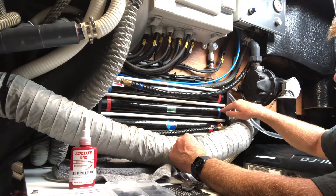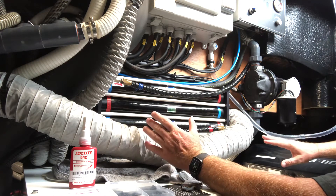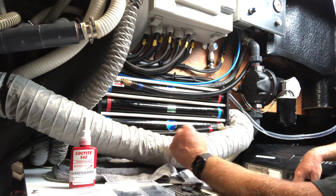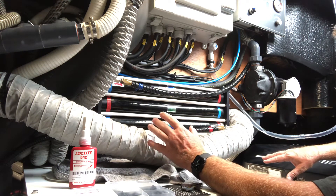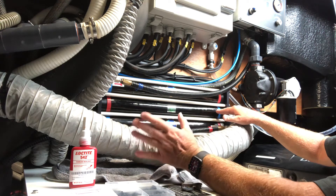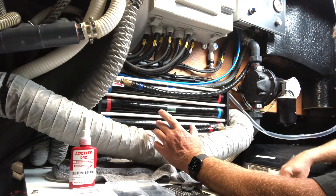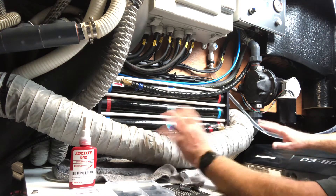Some of the o-rings had fractured or were damaged during disassembly, so it was leaking when I first assembled it. In retrospect, before starting this job I would get two spare interconnectors with factory spec o-rings — I'm going to order those. I put it together with an aftermarket o-ring from the local auto parts store and I'll share the size in a moment, but I'll monitor it to see how it holds up.